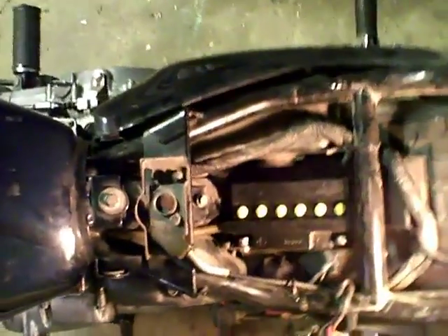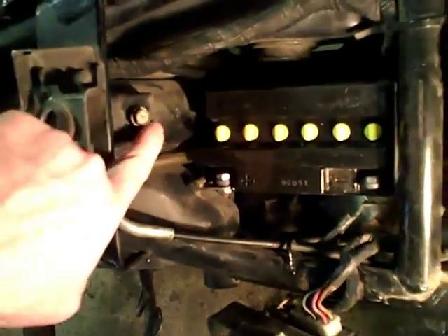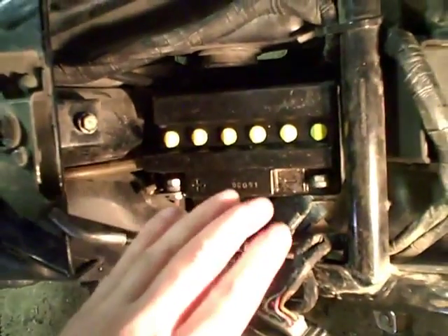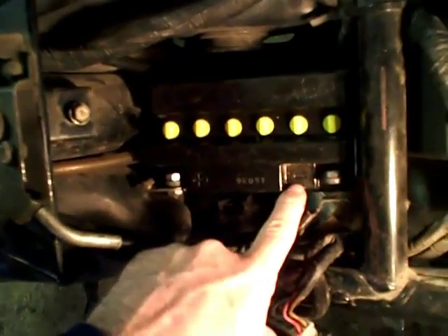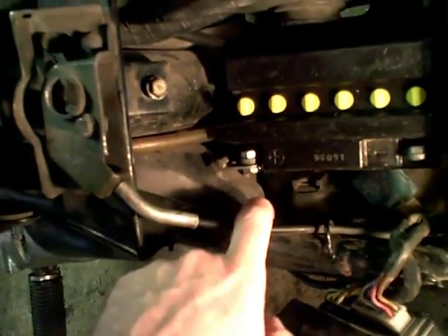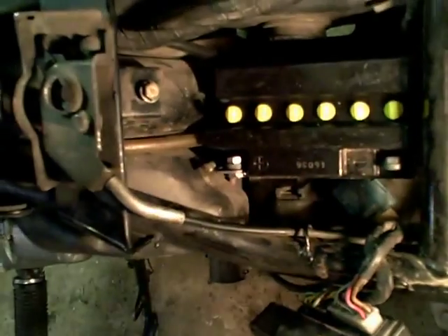I have a mechanism covering the top of my battery, held by a little clamp into one screw and clipped underneath a bar — so it's just one screw and you have full access to your battery. My advice: if your battery is really close to the frame and other metal, take the negative post loose first and move it way out of the way, tuck it somewhere where it's not going to touch. Then when you put a wrench on the positive side, even if you hit something on the frame, you're not going to be making sparks, possibly shocking yourself, catching on fire.